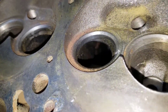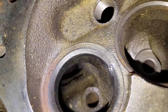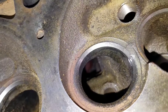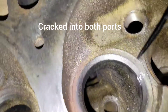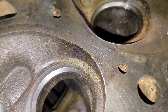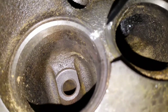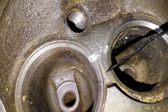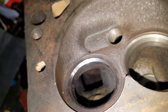It's interesting — they kick it over to the far side, which is great, but the machining they did screwed it. And as you can see by that crack right there — there's a little zipper tie, right there is a crack. And there's another crack over here too, actually right there. I think that's about the only port that isn't cracked — maybe that one too.